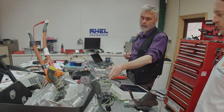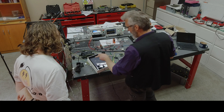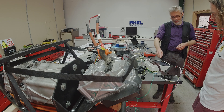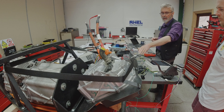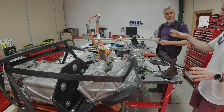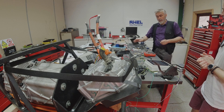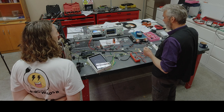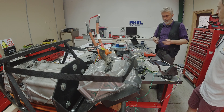The EV Controls unit is now talking to the Tesla unit. We've changed to an original Tesla drive card in the inverter and can see data coming up - the ID and software level coming out of the inverter via CAN bus between the control unit and inverter. The EV Controls T2C is the brains for the motor. The BMS talks to the batteries, ensuring all levels are correct. The charge controller also talks on the CAN bus, understanding battery state of charge and reducing power if the battery runs too flat - essentially a limp mode.